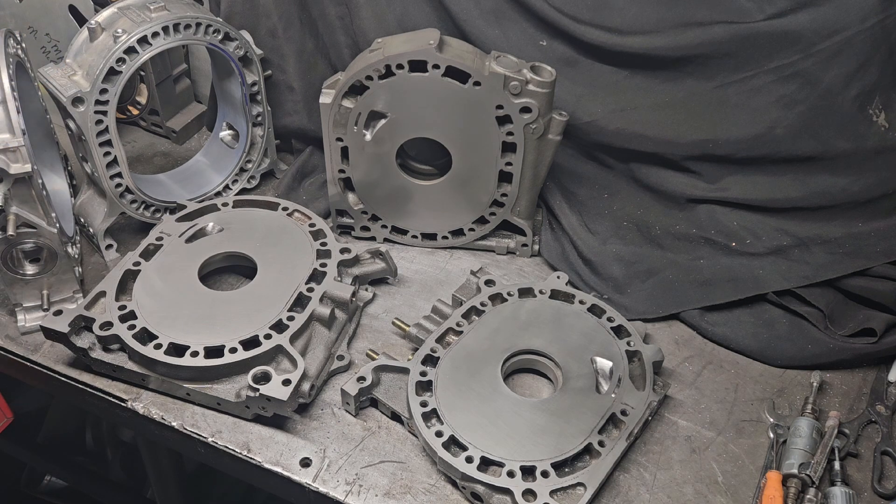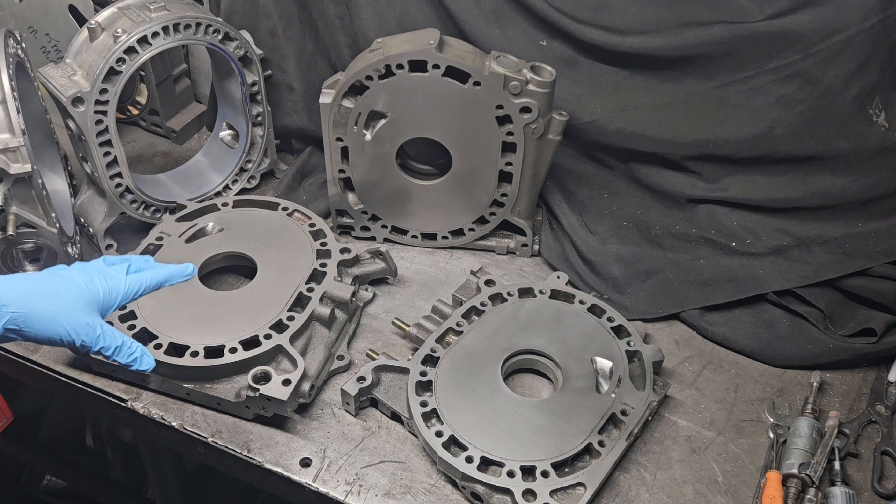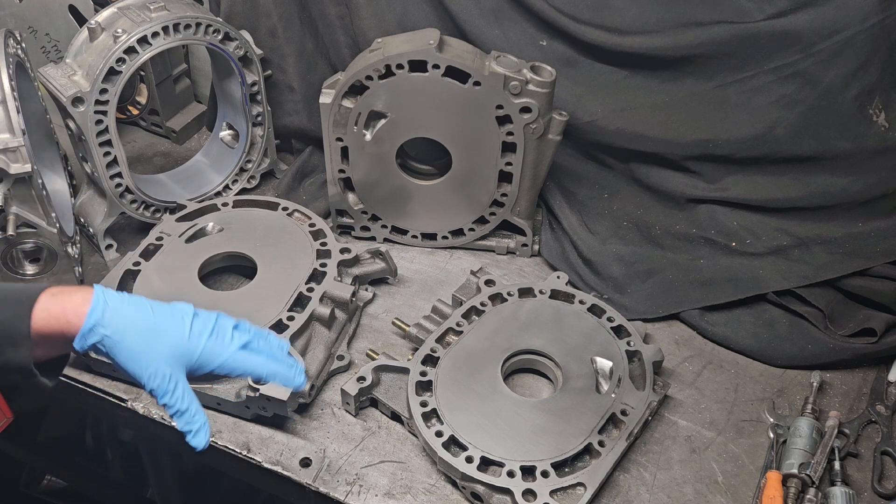So, this is an early version of where a lot of people — rotary enthusiasts, race engine builders, race car drivers, hot rodders — were taking one motor's components and combining them with another motor. Now, this isn't really far off from versions that were available from the factory, because you did have the Repus and the early RXs with four-port motors that were 13B based. You also had the 10As and early twin distributor 12As, which all had variations. So, not to be mistaken with these plates, which are very specifically from the 12A RX-7s.